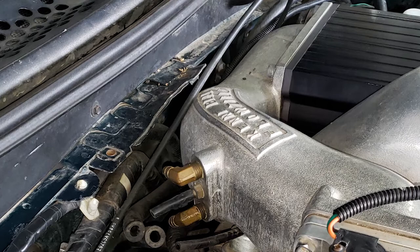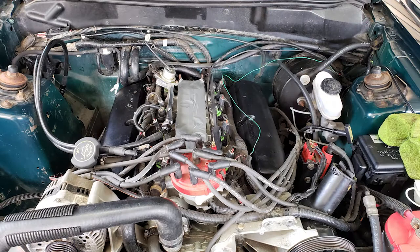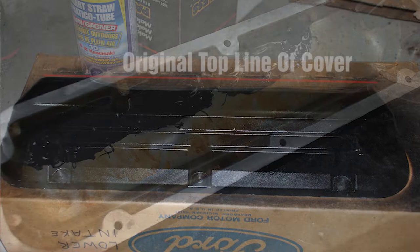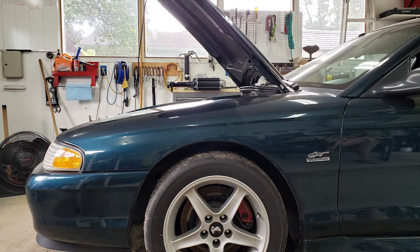My solution was simply to relieve the top of my valve cover — I'm using a Fox-style valve cover, which is a pretty low-profile piece to begin with. We had to hog that out with a flap wheel and reseal it with epoxy and plastic. It isn't pretty, but it does allow the blower to nest into place and keeps me from having to use spacers and stacking gaskets and looking at other clearance issues as the elevation goes up. This system was designed to fit under a stock hood. However, if you put a spacer on or you have a 351 engine with the lower manifold, all bets are off — you're definitely going to have to check your clearances, run a different hood, and look at your motor mount solutions.